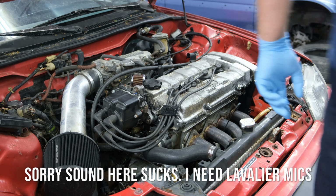And to get the hose on, it was kinked going up because it was basically against the intake manifold right here. So I think it wasn't allowing pressure back into the tank, which was holding too much pressure in the fuel rail. Thankfully, I got a lot of Honda parts around here, and I took the fuel pressure regulator off my D16, that's for the wagon, put it on here, and it seems to be doing a lot better.